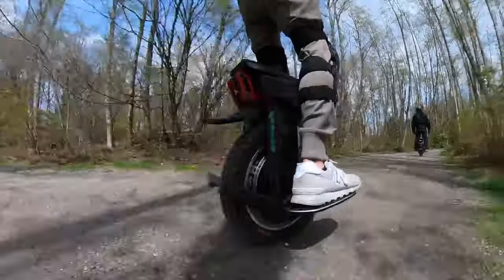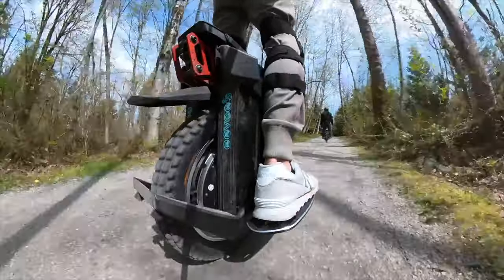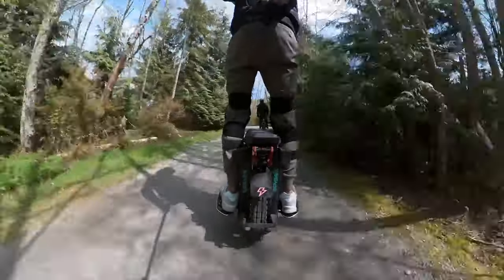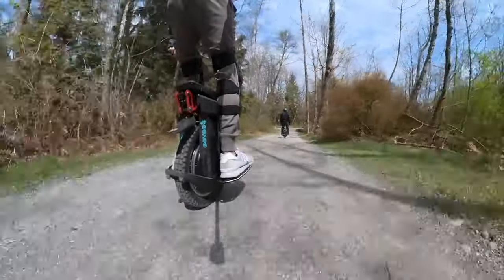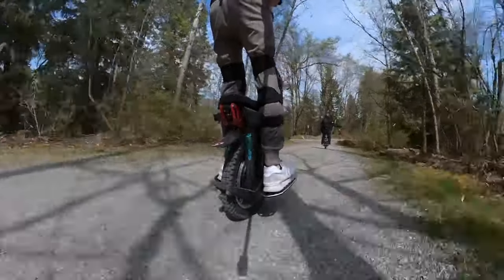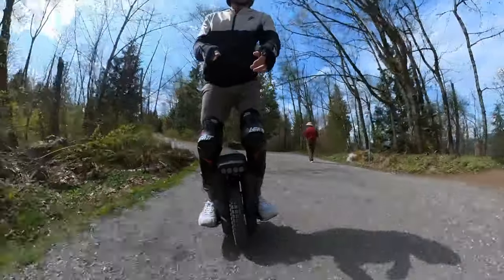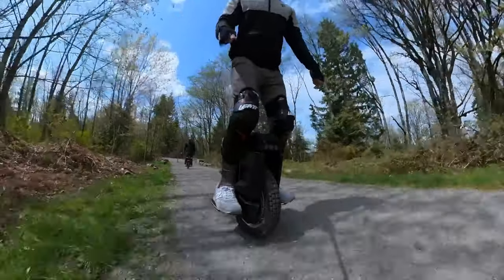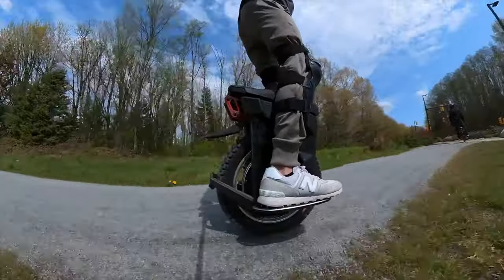I've heard that a lot of them are losing air, or the rebound control is breaking on them and not working. People are going to be switching those things out. We actually put a coil suspension on, the DNM one, but we only put a 750-pound spring, and I was bottoming out just by standing on it. But riding home, the fact that it was riding a little bit lower was really nice. More stability. But I don't know if it's going to have enough travel to ever give you an S22 suspension experience. No, you just don't have the room. It's going to bottom out still.